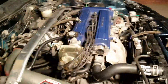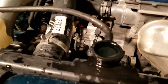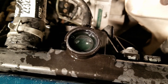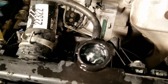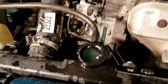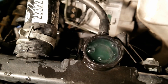You can see little fuzzy or paper-looking pieces coming out — that's the reason for the flush. The system wasn't extremely dirty but there is old coolant in there. I'm switching to Peak Honda/Acura OEM coolant for early 2000s/late 90s vehicles. I don't want to mix coolants and have it turn to sludge, and with debris like that in the system I'd rather just flush it to be safe.